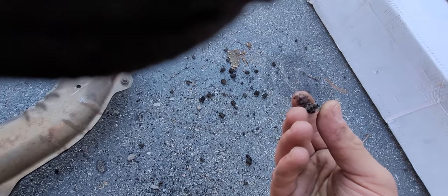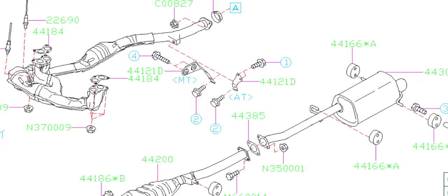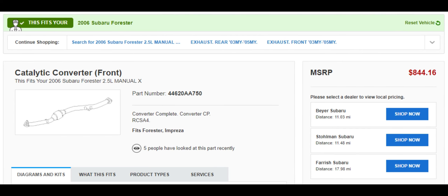So like I promised, if you don't address the root cause of why your downstream catalytic converter failed, you'll just be doing this again — and you don't really want to wind up paying for this. Most Subarus have two catalytic converters: one is right here in the front, coming off of the exhaust manifold, and that's flanked by two oxygen sensors. And then there's one downstream catalytic converter right here, and that's the one I replaced. And unless you buy Chinesium like me, these things are expensive. With a car reaching 170,000 miles like mine, that's looking an awful lot like what the car is worth.